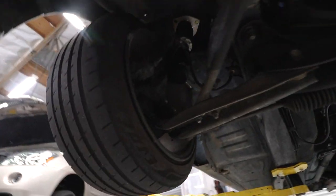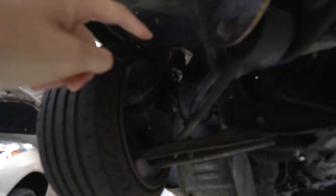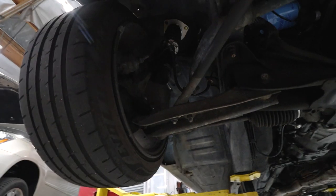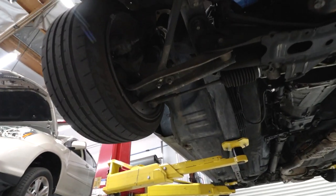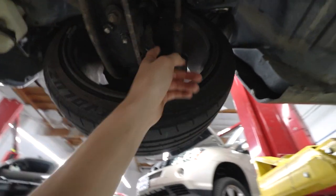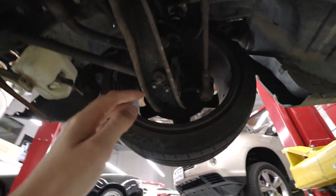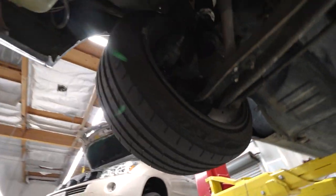Here are the goodies that no one gets to see. I feel like my front suspension game is weak at the moment. I have GK Tech roll center correction and BC coilovers — those are nice additions, but I do plan on doing a suspension overhaul soon. You can hear that — this tie rod end is kind of shot. I definitely have to replace that. I'm really hoping it didn't mess up the hubs, because if it did I have to replace those too.